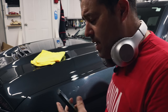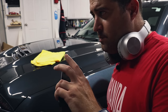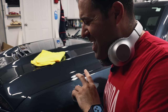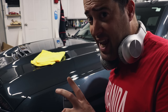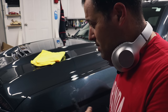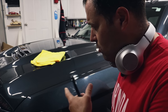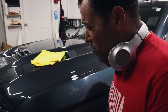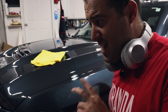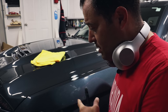So what that means for a paint correction is we're doing one moderate hit with compound. That's it. We're not going to try to dig out any more than that. Some areas may only get 80%. That's as far as we can go. That's the limit. In fact, next time, I'm going to have to tell the owner, the paint is thin on this. If you get any more scratches or swirls or water spots or anything like that, then we really can't go any further. We're just going to have to do, say, an all-in-one polish or a light paint enhancement, and that's it. Because at least that doesn't take off as much clear coat as paint correction does.